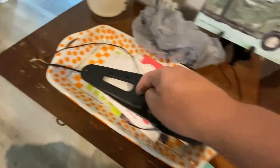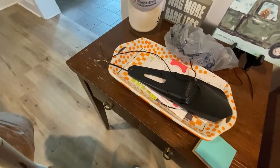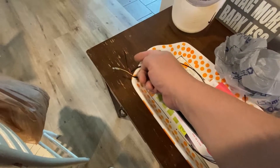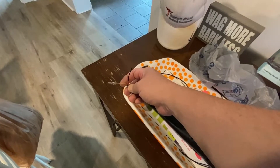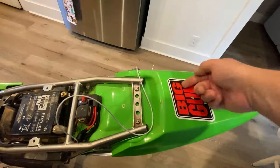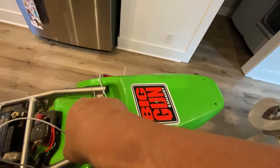This LED running light takes almost no current and it's right here. There'll be a link in the description for the tail light — it's an Amazon item, perfect for this. The yellow wire is the running light, the red is the brake light (we just need a running light), and the black is ground. I've added a bullet connector on the splitter coming back from the front. I'll mount the tail light underneath, cut the wire to fit, put the connector on, and drill a hole with a rubber grommet to run the wires through.